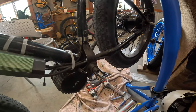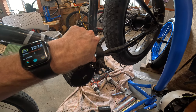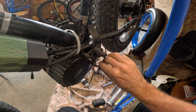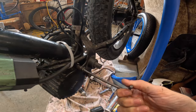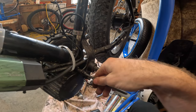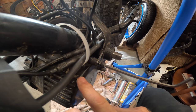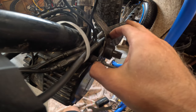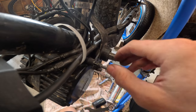Now that we've got the inner lock ring out, we're going to loosen these two bolts and also the bolt on the hose clamp so I can take the stabilizer bar out. We've got a 5mm allen here — and they weren't very tight at all, they were basically hand tight. I should tighten those up every once in a while — I sure didn't. On the fat bike version of the BBSHD there's a little spacer, and if your stabilizer bar isn't coming over straight you can put some washers in to fill the gap.